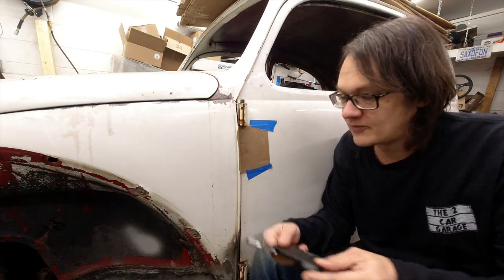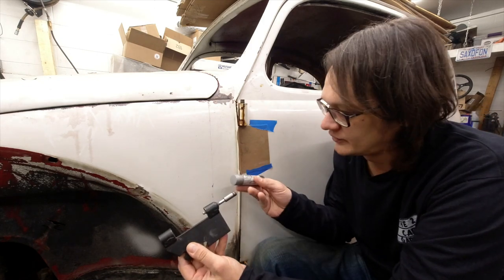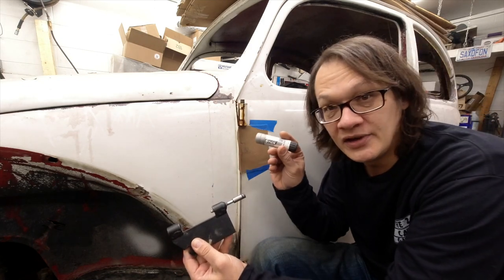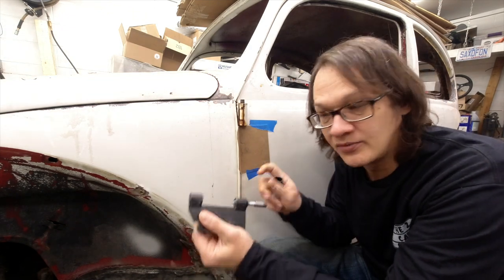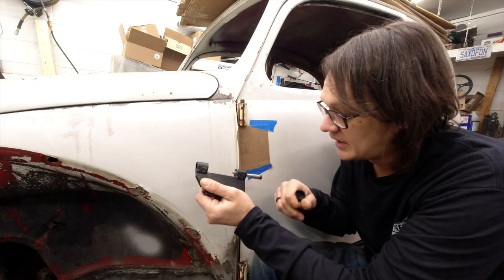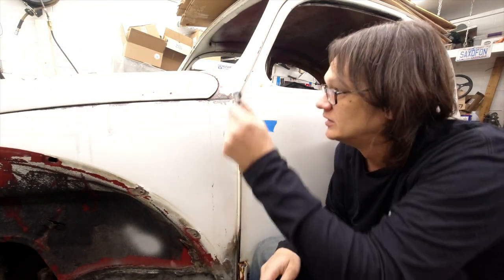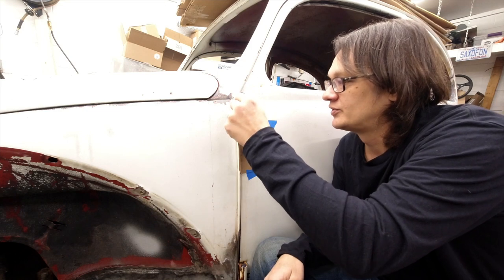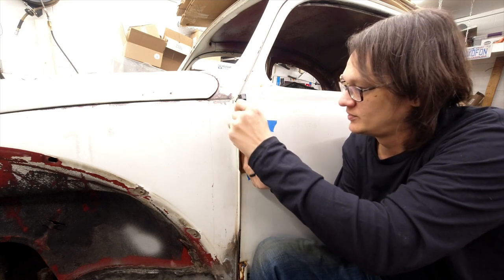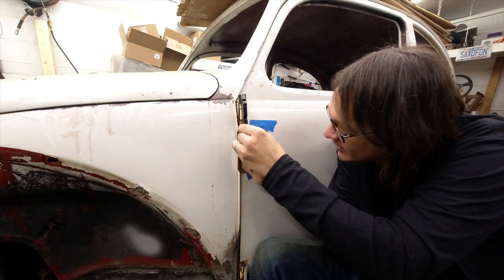I really want to have the best shot of getting this out as possible, so it's worth the extra time upfront to hopefully make things go a little better. For the puller, I took some silver anti-seize and put that on the threads just to lubricate them, make things move a little nicer, and hopefully make this cheap bolt last a little bit. Really all we do is just slide this over and get things lined up on the bottom.